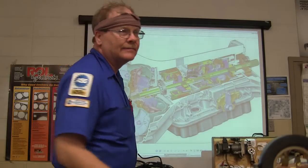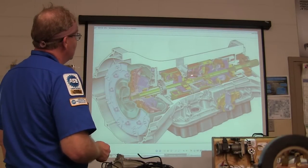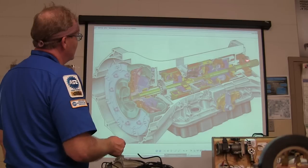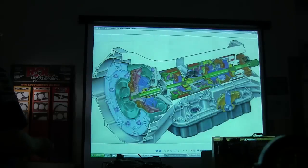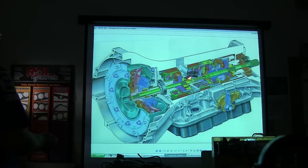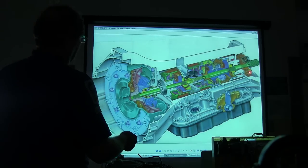You can change them real easy and they don't cost all that much either. This right here is a speed sensor, and this is another speed sensor. There is a turbine speed sensor and an output shaft speed sensor, and some have an intermediate shaft speed sensor. Back here is where when you put it in park, you've got a little parking pawl that locks into that dog back there.